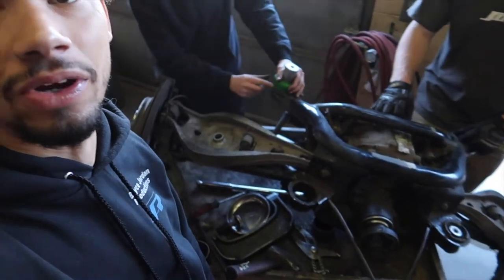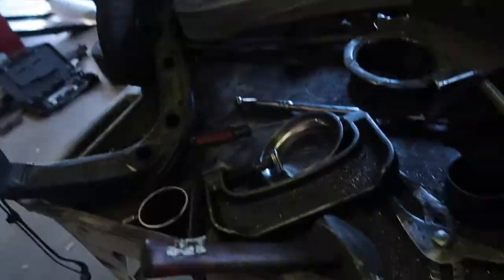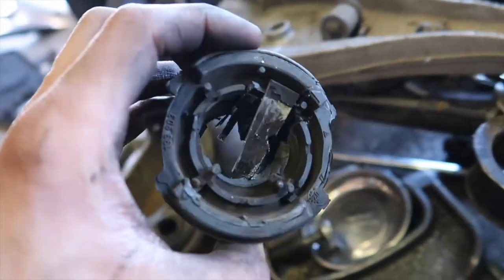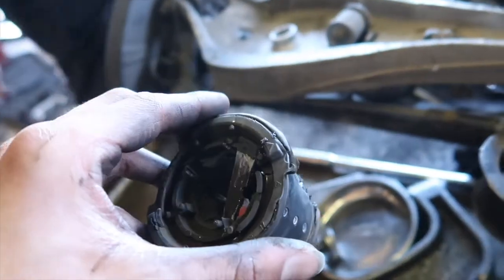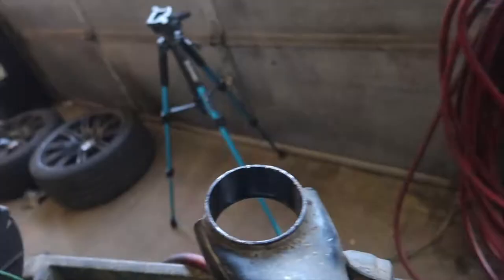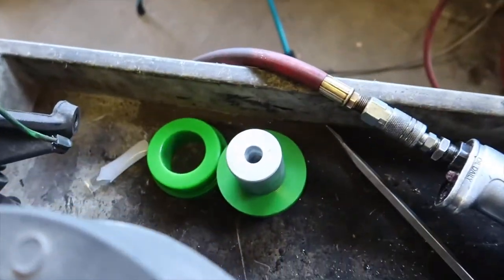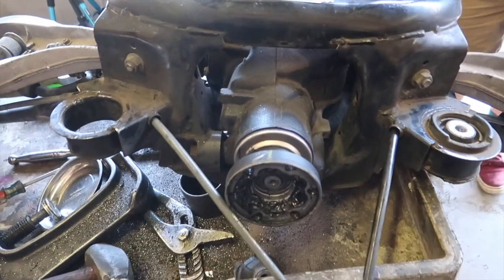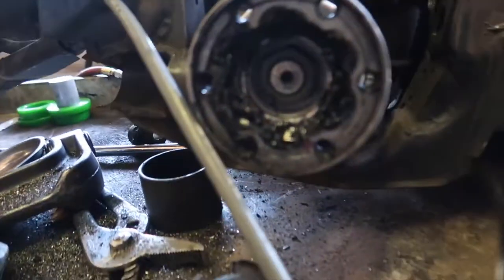What's up guys, we are day two at the auto hobby. Got the rear end out of the car again. Got three out of the four subframe bushings out — we've been having to press the centers out, then cut them for some relief, and then hammer them out. We've got one left. We'll get the other one out, put the new bushings in for the rear, put the subframe back in, and then take the diff out and do the three diff bushings and the new gasket.